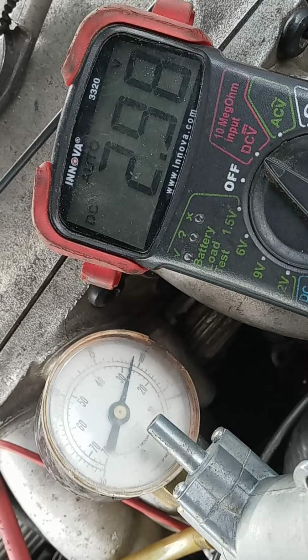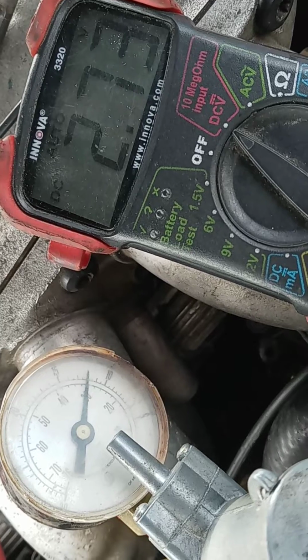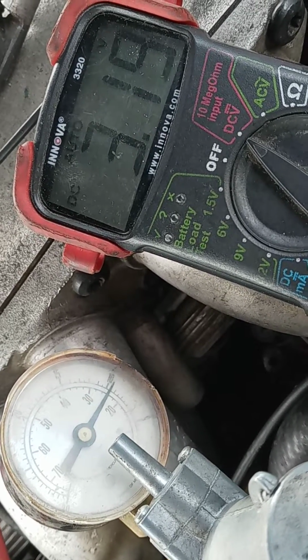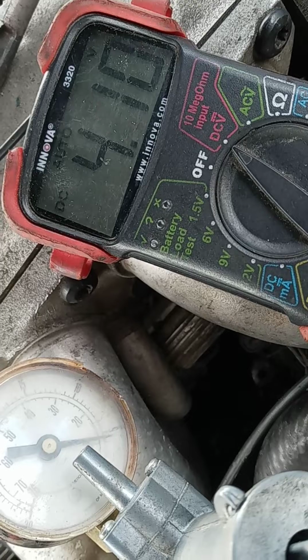just like it's doing. So you can see both the gauges moving, but there is a problem when I hold the pump steady. You can see the needles dropping little by little, and the pressure, or the voltage, excuse me, is changing while the pressure drops, and it's increasing back up towards 5 volts, which is where it's supposed to be.